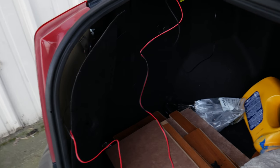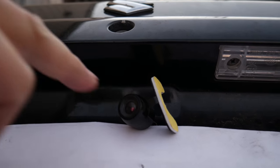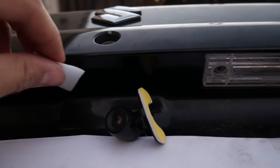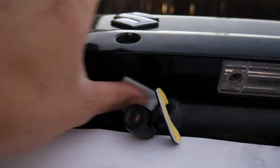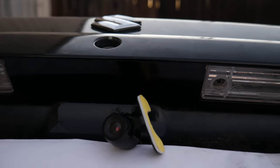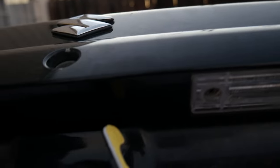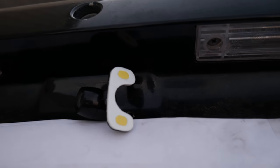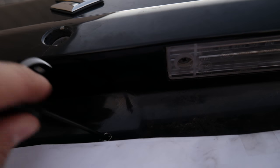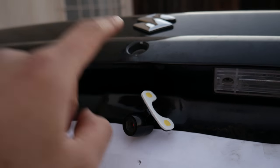The only thing left is to put everything back, tuck in the wires, and finalize the installation. We're ready to mount the camera into the bottom of the keyhole. I got an alcohol swab to clean the surface so there's no residue, then dry it off with a rag. Remove the yellow protective cover to expose the adhesive, and line it up so the tip of the camera sits flush to the keyhole ridge.